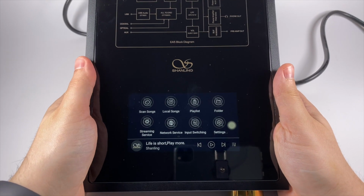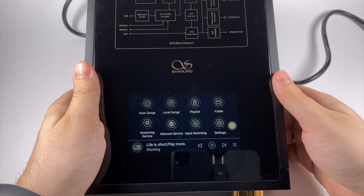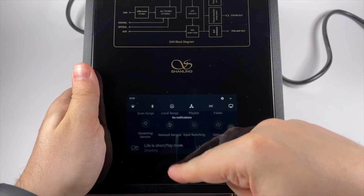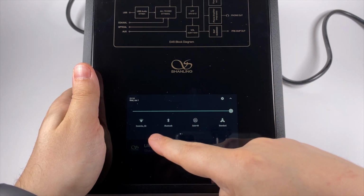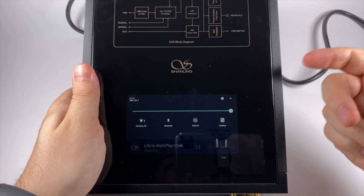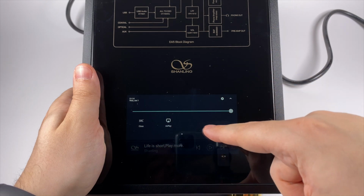In terms of firmware, it's a pretty familiar Shanling interface with one exception. Instead of an open Android system with a regular desktop, you'll get their custom launcher that is focused on particular features. So, as you can see, after boot up there are 8 icons on the main screen, but actually, as many can expect, you can drag down this thing with settings. So Wi-Fi, Bluetooth, gain selector, desktop, game mode, and standard. It's 3 different types of sound enhancement. It gives you a bit different stage. And SRC, it's an upsampler, and AirPlay you can activate here, and also change brightness.